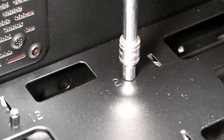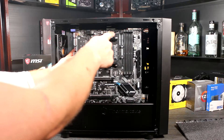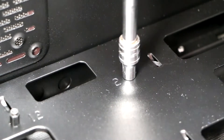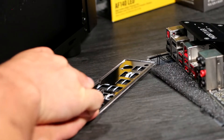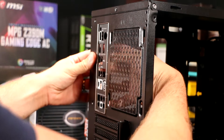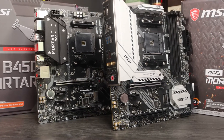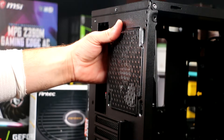We need to check that the standoffs are in place so that the motherboard is properly supported. Compare the position of the standoffs in the motherboard tray with the standoff holes in your motherboard. Add any that are missing to the relevant spots. They just need to be nipped up — don't over-tighten them. Most have a crosshead to allow you to do this with a screwdriver, but mine don't, so I'm using a 5mm hex socket to screw them into place. Once your standoffs are in place, it's time to install the IO backplate. A quick tip here is to bend the small tabs on the inside face perpendicular — this will help you fit the motherboard later. Take note of the socket layout on the motherboard to ensure you get it the right way round, and press it into place from the inside of the case. Watch out because it has sharp edges. Higher end motherboards sometimes have this integrated into the motherboard around the IO panel, so you can skip this step. You may find it helpful to remove the rear fan at this point to free up the workspace inside the case, so just unscrew and remove it and set it aside for now.